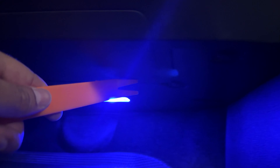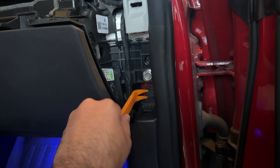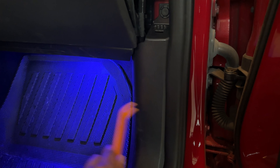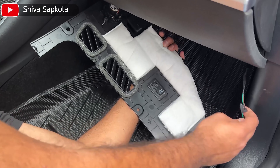To make the computer connection, we're going to open up this glove box panel, which is held down by several plastic clips — just use a pry tool to remove them. For the Intel computer, your plug is going to be right here. For the AMD ones, you also want to remove this pillar and pry up on the clip there. There will be a blue plug for the AMD connection and a white plug for power. Remove those four plastic screws using the pry tool. Once the panel is removed, you'll see the LED light connector — remove it by pinching the middle tab and pulling it out.